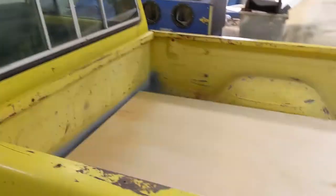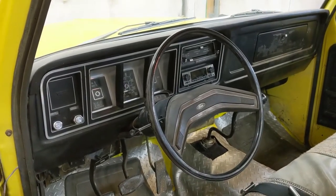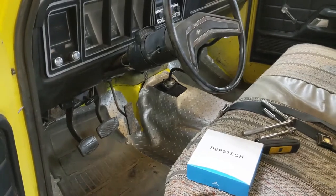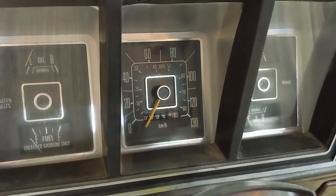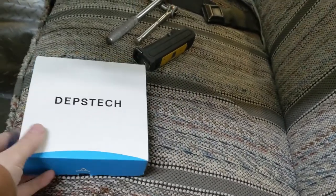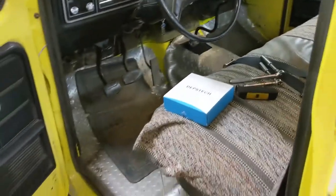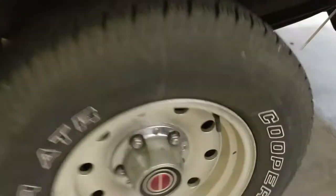Back on the F-150. I went to get a load of plywood the other day — it looks good. I'm trying to figure out the right color of speedometer gears to put in this rig. There have been a lot of changes done over the years: there was a four-speed overdrive in this truck, then they had an FMX transmission, and now I've put an NP 435 New Process in it. So I need to find out the gear colors, and I also have to reset the speedometer needle — it looks like someone may have taken it off and readjusted it. I'll have to pull the dash apart and do that. I'll use my bore scope to go inside the transmission tail shaft area and see what color the drive gear is. I have two driven gears: a tan and a yellow, but I may not be able to use those — it'll all be based on the drive gear in the transmission and the tire size.